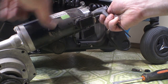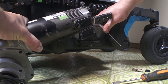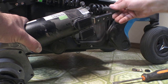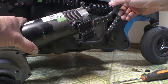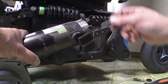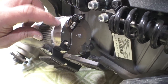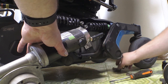There are some little 3mm allen keys holding this bracket on. It seems weird to design and bolt on a big metal bracket just to hold some velcro — seems like we could have used push clamps or something else. But I guess if it works, that's fine. This is one of the bolts that also holds the brake mechanism onto the motor. You can see where this bracket picks up that hole, and there's another one here, plus two more bolts holding the brake unit onto the motor itself.